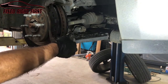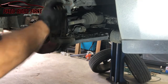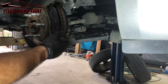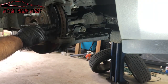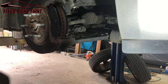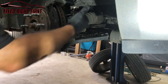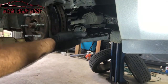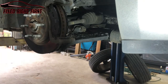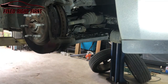Like I said, I do recommend replacing these pieces of metal. They're the hardware kits. They're just extra retainers and silencers. It keeps it from making noise and keeps it in the caliper bracket better. But most pads don't come with them unless they're an OEM or an expensive, quality pad. You can also put silicone on the mating surfaces and across the top and bottom. I don't like to do that with old hardware because sometimes it just makes a dirty mess. So I'm gonna leave it off and just install them. But if you replace the hardware, I do recommend putting the silicone on.